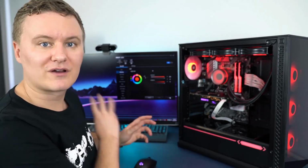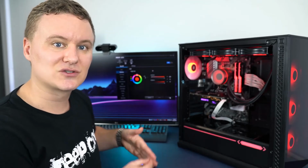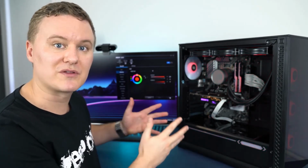If you want to choose something different than just a static color, one of the effects, then you just select the effect. As long as the 3-pin 5-volt connector is connected to the 3-pin 5-volt header on your motherboard and all of the RGB connectors are connected at the back of the case, you shouldn't have any issue, and this should be the final outcome.